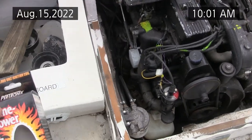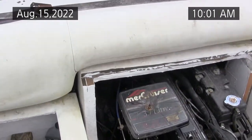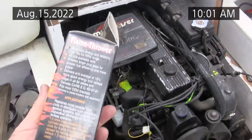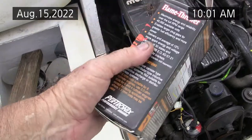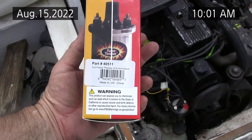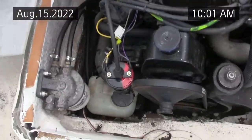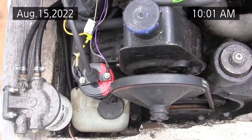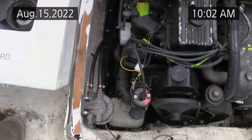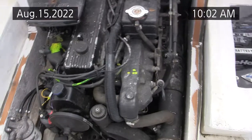Just finished swapping out the ignition coil on this 3.7 liter Mercruiser. This is a MCM 470, vintage 1989, that I've had since it was new. This coil is model number — I got it from Breezeworks.net, Kevin at Breezeworks.net, part number 40511. It has the built-in internal resistor, and I've marked the positive side with red paint. This is a slightly larger diameter than the one I took out, which I don't know if that was aftermarket or OEM, but now I've got a spare coil.